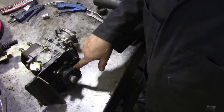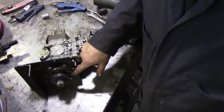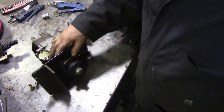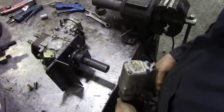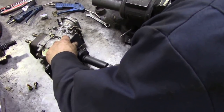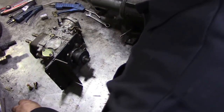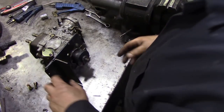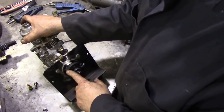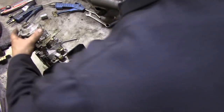The thing is you can crack the casting, which has been kind of common on here. A lot of people have cracked the castings by turning over the engine with the timing pin in and it just cracks. So let's spin that off. The pump turned around a bit but we're not really bothered too much about that. The next thing we're going to do is put this in the vice and turn the pump round until the pin is in its firing position at top dead centre.